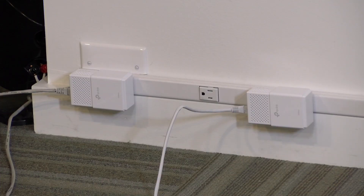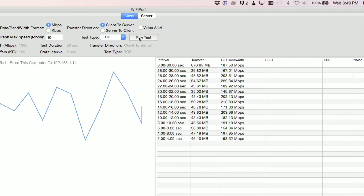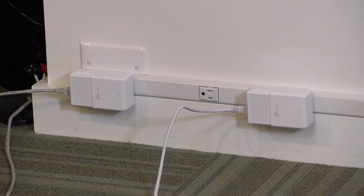Now let's see how the TP-Link performs in the same configuration. It did a little better than the Comtrend and certainly a lot better than the TP-Link did in the real-world test scenario — these were now performing at about 187 megabits per second when on the same circuit. There's a lot that can interfere with powerline devices: things plugged into your electrical sockets in other parts of the house, and if you've got multiple breaker boxes, the signal has to travel through all that electrical wiring. I found it's just never a consistent or fast experience, never anywhere near gigabit speed.